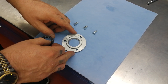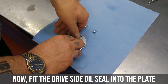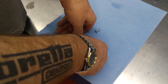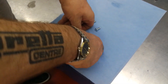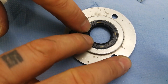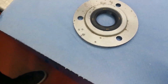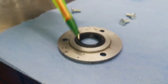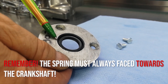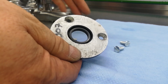As mentioned, the CP135 kit can be used with all standard parts if needed. Now we fit the oil seal into the plate — it should be a fairly easy fit with a little pressure, pushing it down evenly all the way around until you can feel it is flush as you run your finger around. The oil seal is now flat and flush, and remember the spring must always face towards the crankshaft.